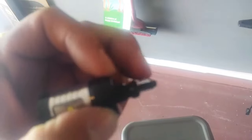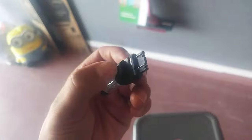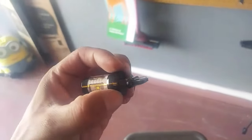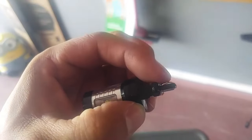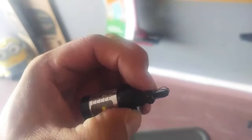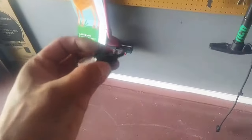So the key to making these work correctly — these prongs up here, see how they have an arch right up here that connects to your power source. I left this side down just to show you the difference. Give them an arch, lift them up with your fingernail and stick a really skinny small screwdriver underneath them and push them back down. That should give you the arch that you need so that these things aren't moving around while you're driving and flickering on and off. So remember that.